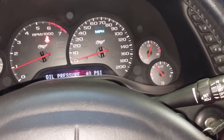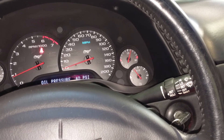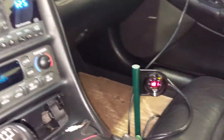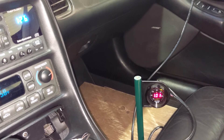As for me, after using a wideband for several years, I have found that once my tune is where I want it, my wide open throttle air fuel ratio is pretty much dialed in. So these days I tend to only hook up my wideband oxygen sensor on a temporary setup a few times a year for a little tuning or a weekend at the track.